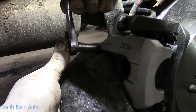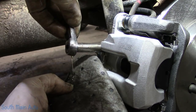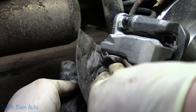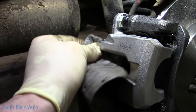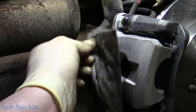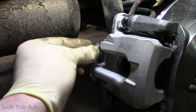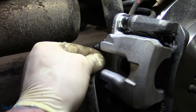Okay, just hold down on the pedal just a little bit. Just turn the pump on. Okay. Yeah, you can let up. I'll have to hose this off with some of the good stuff. These are super easy to bleed because the little electric pump kicks on. It's like the old 4Runners and stuff. All right. Thanks, Mrs. O. You did good. I'm gonna fill that bleeder cap full of the fluid film and stick that on there. Hopefully keep that from corroding.